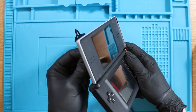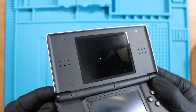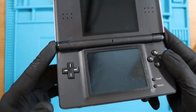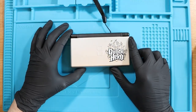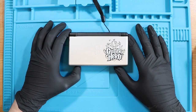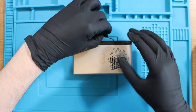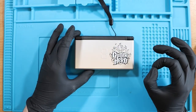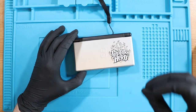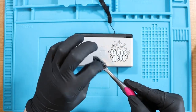I've tried a different battery already, so we know it's definitely not a battery issue, and the battery I tried was fully charged. You can see there's pixel damage or leaking going on in the top screen, so I'm pretty sure the top screen will not work, though the bottom screen seems fine. I was scouring the internet and stumbled across one of my own videos from December where the fix was to take it apart, give it a good clean, put it back together, and it turned on. I want to first try removing and reseating both ribbon cables for the top LCD and bottom, and then see if that works.